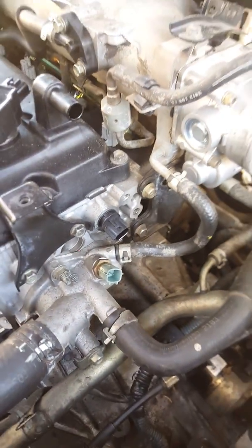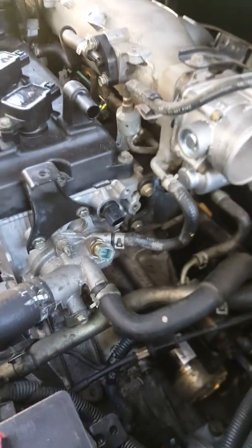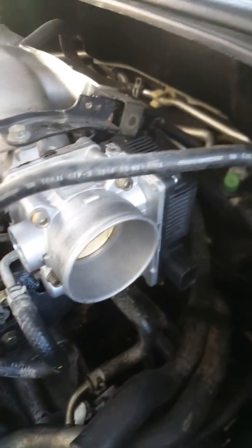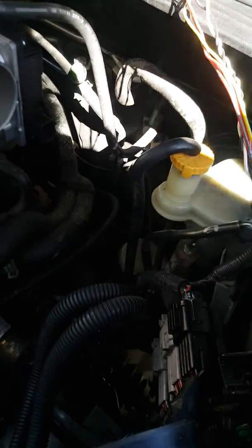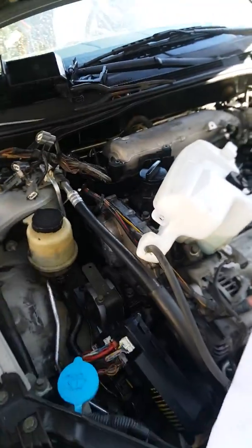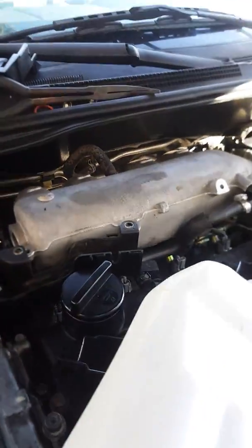Then I used some of the advice that some other people told me and said disconnect all your sensors, which created a hell of a lot of work. I disconnected all the sensors and did troubleshooting. I was still shorting out, couldn't figure it out. So then I took the old-fashioned Volkswagen bug approach and started disassembling the harness and just started going through the harness.